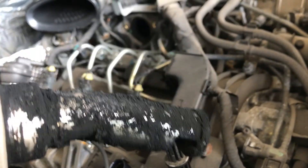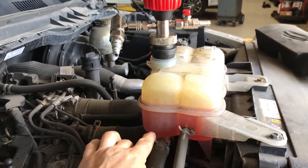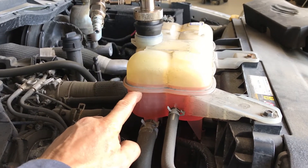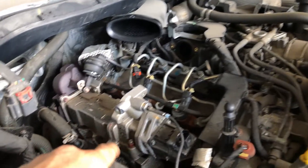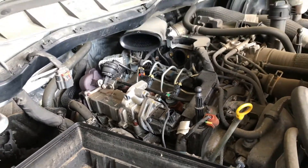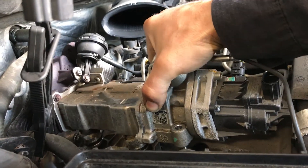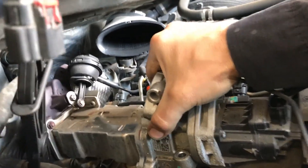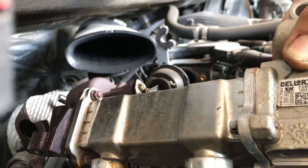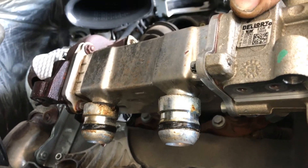You can see a lot of soot inside. I'm going to apply a little vacuum to the coolant system — the coolant was somewhere in here, and after applying vacuum it sucked the coolant up to the bottle. That way I won't have any leaks when I lift the EGR cooler. Normally you would have coolant leaking through here, but because we put a vacuum on it, you don't lose any coolant.